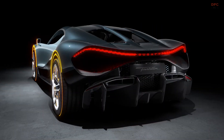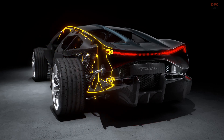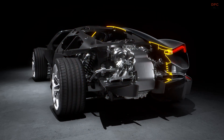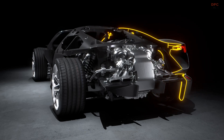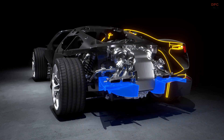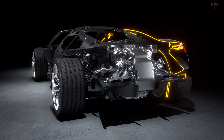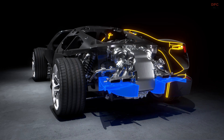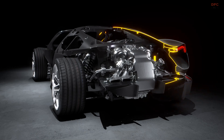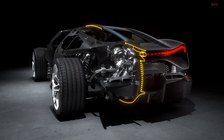Here at the rear of the car we have the heart of the car: the naturally aspirated V16 engine. You can see what we've had to do to keep the wheelbase of the car under control. It's a very long engine, but the wheelbase is actually only 29 millimetres longer than the Chiron. We've done that by pushing the engine right forward; the fuel tanks have moved to the side, and it means the engine is very close behind the driver and passenger, which keeps the car compact.